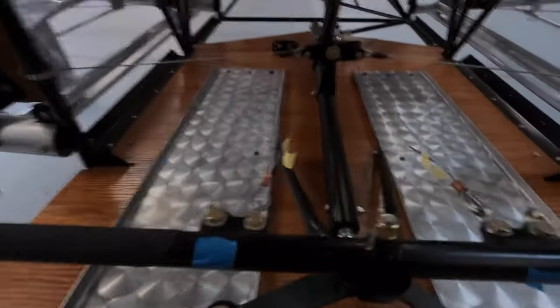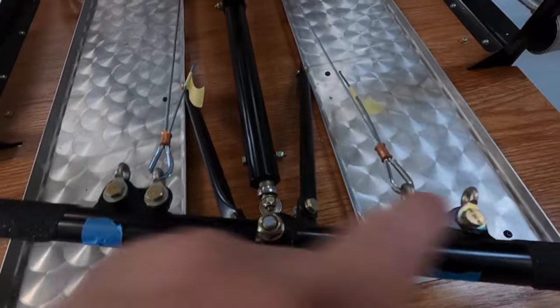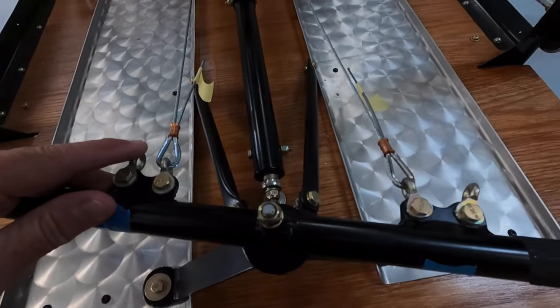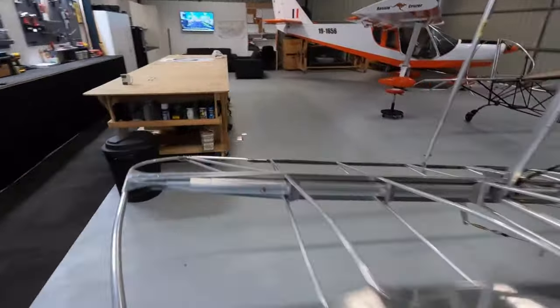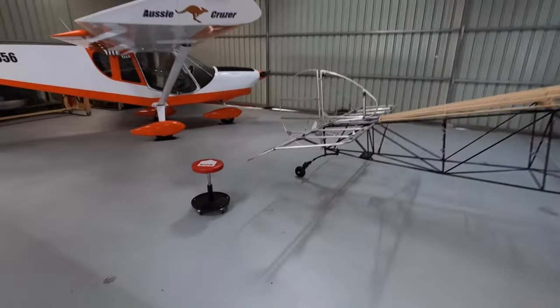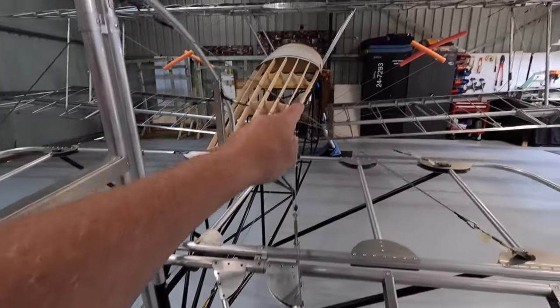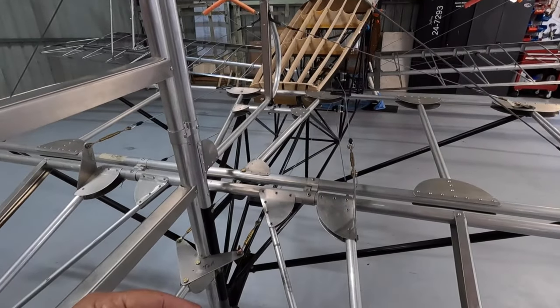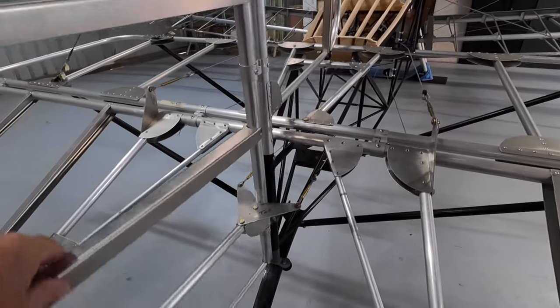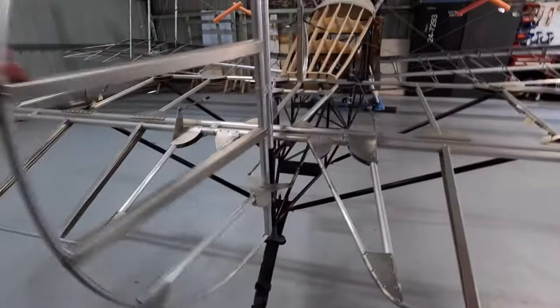Because this pivot point is behind the other one, you get more pull than push value — only slightly, but it's enough to upset my rudder. So I made a new horn, moved the holes back the same distance that the offset is up front, so you get more — the same as up the front — more pull than push. Now I've got full and free rudder. That was worth the effort. Now we're going to do some fair leads.